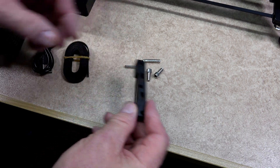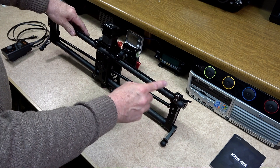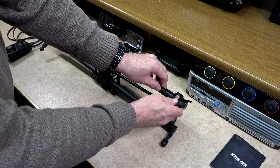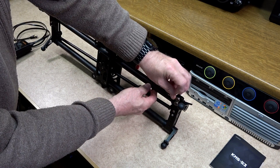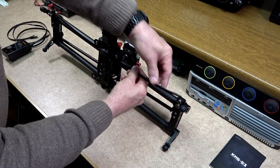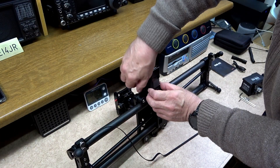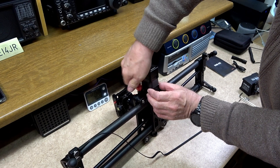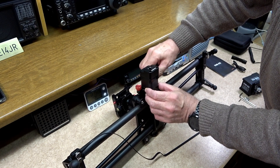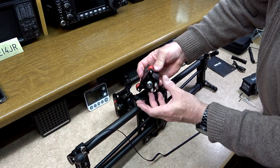Although your P1 slider already has a belt fitted from when you first bought it, they do provide you with another belt. The first job is to slacken and remove one end of the belt from the slider. If your belt is in good condition there is no need to change it for one of the new belts. When one end is free, feed it away from the pulley unit on the old motor. Undo the two screws — the red knobs — anti-clockwise until the motor is freed. The old motor has now been removed.